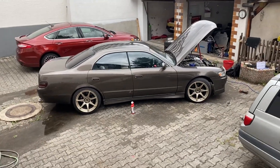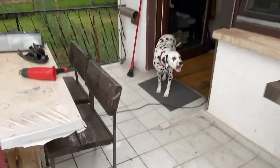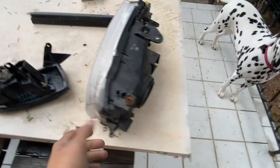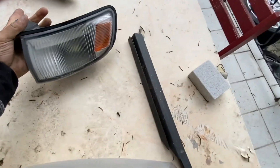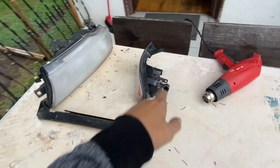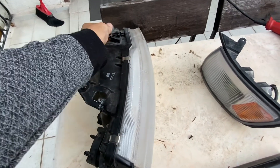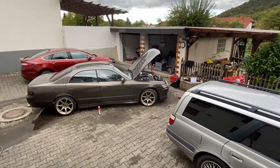The wheels are on and it definitely looks a lot better. Fitment on the rear is pretty good; the front is going to need to come down a little bit, but we'll take it around and see if it scrapes. I also plastic-welded the tabs on the headlights because they were all broken — the ones that had the black spray on them. I scuffed them all down, and since I didn't have any epoxy I used super glue over the plastic weld. It's holding nice and sturdy now, so previously they were electrical-taped together because those tabs were broken.